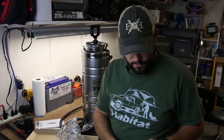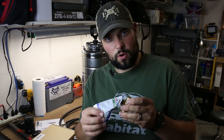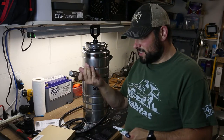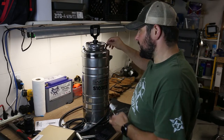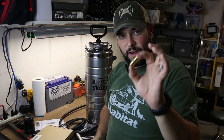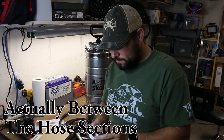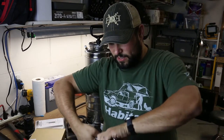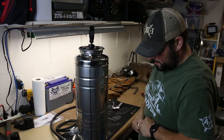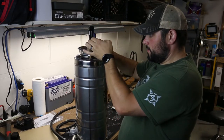The shower head itself is this little vegetable sprayer nozzle. The other things you need are a quarter-inch by quarter-inch ball valve — I added it as a redundancy to keep pressure off the components when not in use — and a depressurization unit like you'd see on a compressor, plus a quarter-inch by quarter-inch connector piece to go between the ball valve and the hose. You'll also need some plumber's tape. The pump sprayer already comes with plumber's tape on that fitting, so I'm going to get it screwed on.